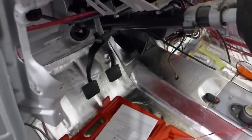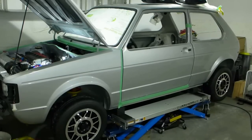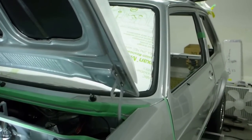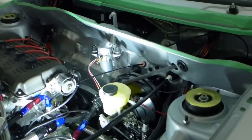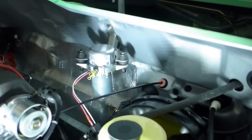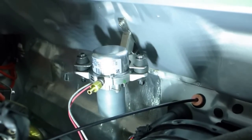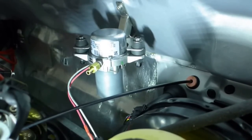With the two oldest boys coming home for the holidays, need to hang the door to get the car out of the basement, finish the dash and wiring, and maybe build the air conditioning system. Instead of mounting the vacuum pump hanging from the cross brace — a bit too kludgy — built a small seamless bracket hanging it from two holes on the rain tray wall that originally held the ignition coil, with rubber isolators.